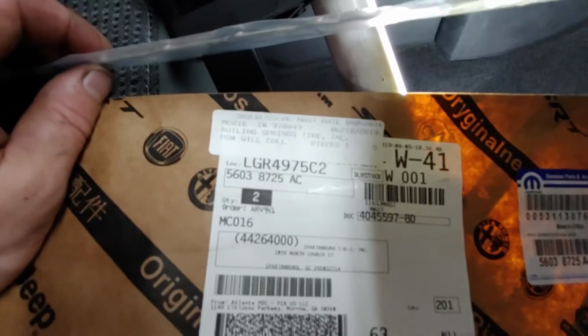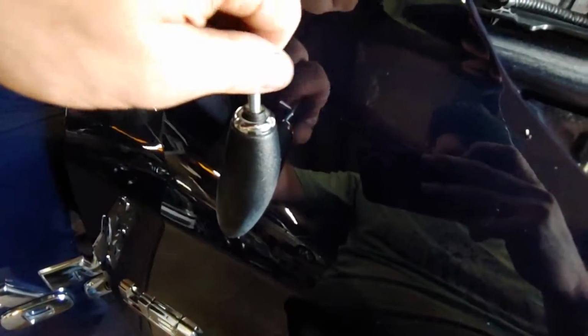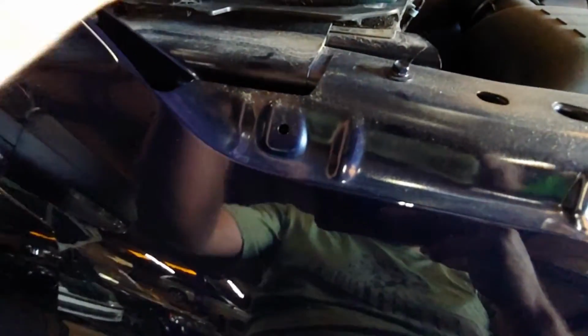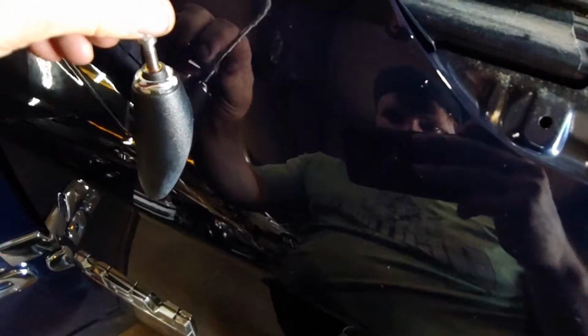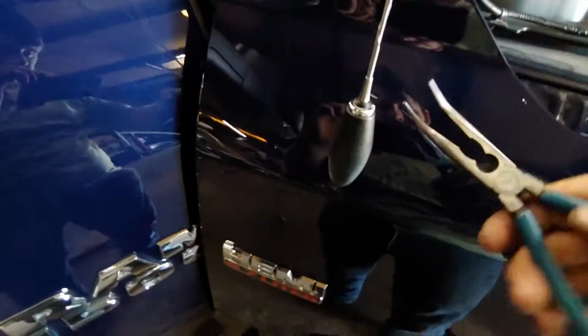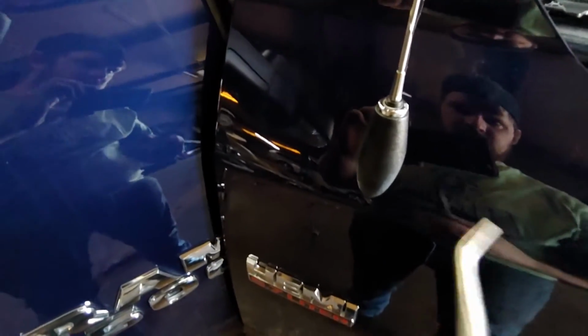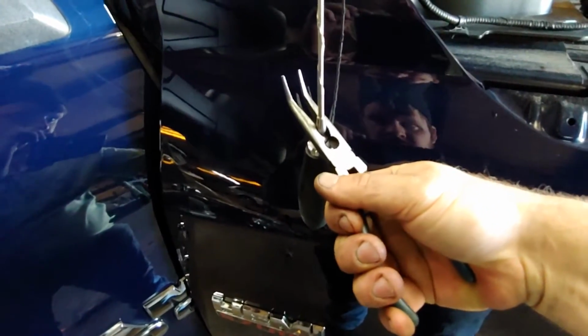Well, all you gotta do now is put the mast back on. Here's your antenna and part number, and this will be going outside. This little piece here just aids in installation. You're gonna wanna take this out. Put your new antenna in the hole. Screw it down. Then just grab it on the flat edges. Give it a good tweak. That's it.